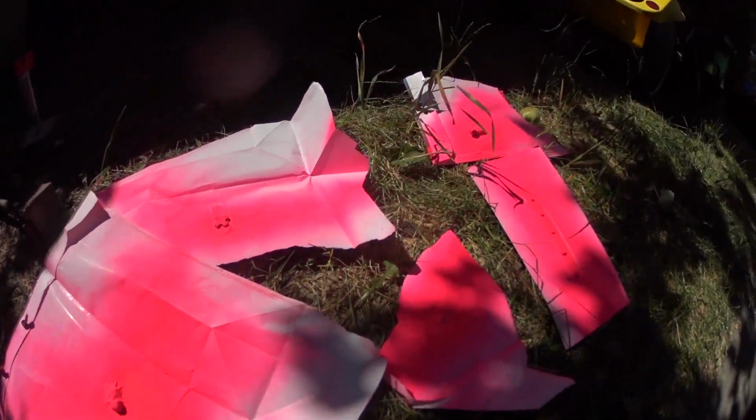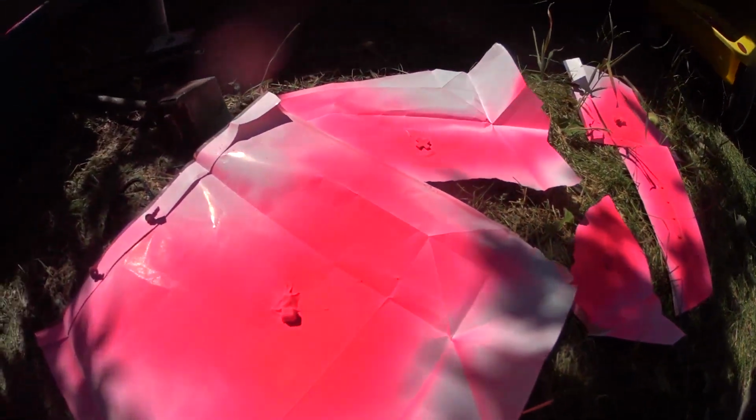I'm pretty happy with how those turned out. Now the final step is the clear coat. The trick to laying down a good clear coat is not exactly the same as getting good coverage with the base. You want to spray a light layer to introduce the clear coat to the surface, and then you want to go over and do a heavier layer. Not a thick, heavy layer, but just enough to get a good flow over top so you get that nice glossy coat.